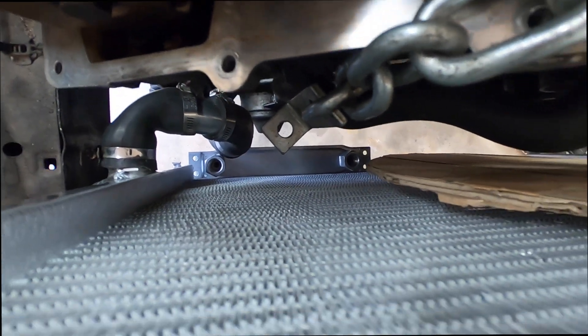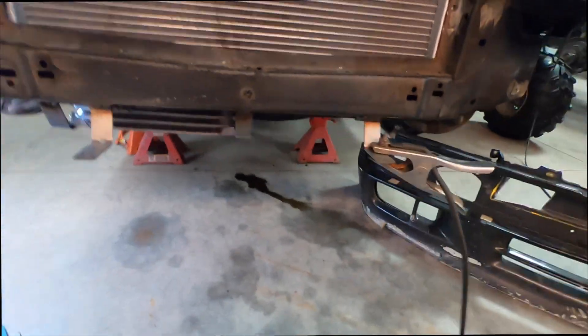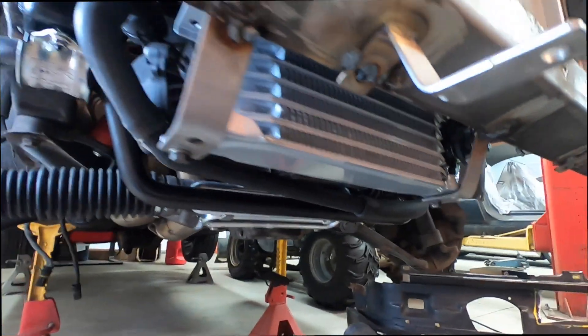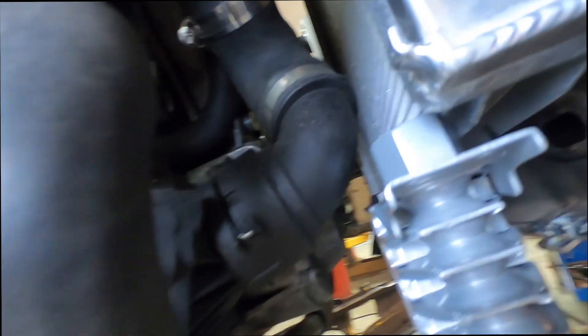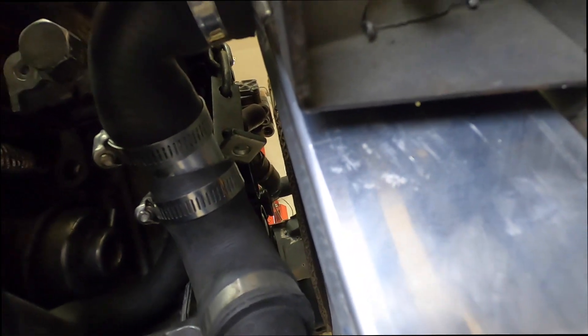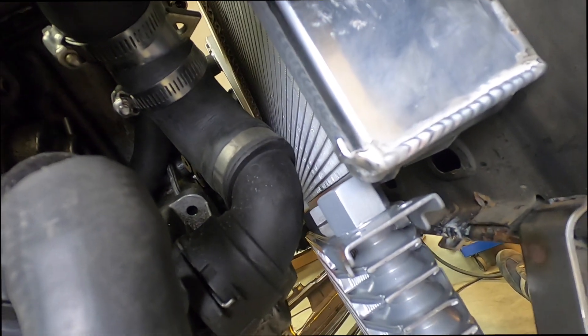This bracket has been tacked on — it is straight to the radiator, which is exactly what we want. It's in really good shape; it's a little bit lower in the front, but that's something I can adjust. I'm going to need to clean up and re-weld all this, but I just wanted to tack everything in place to get it fit. You can see there is enough room for the NPT fitting and the hose to go all the way up through and snake into the oil cooler.